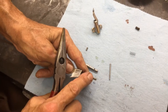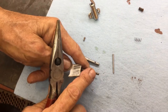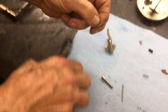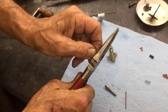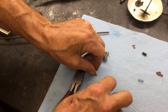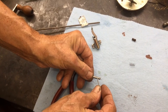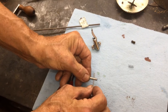This is just a piece of steel I'm showing you. You don't want to cut all the way through, but what that does is it mushrooms the steel. I'm going to cut it on this right here — I'll use this old pin. You take the old pin and you mushroom it, but you have to be very careful. Then it's going to go into the hole and expand to hold it in place, because sometimes the pins are wobbling.